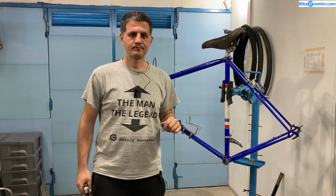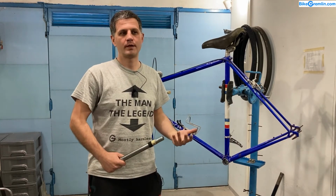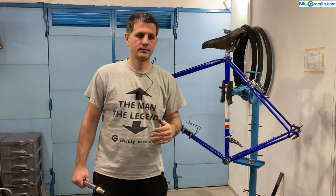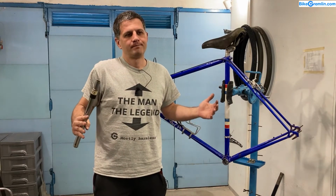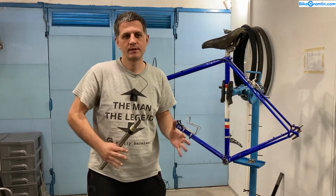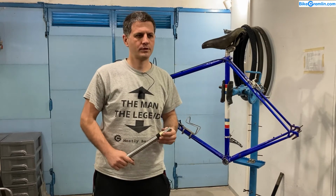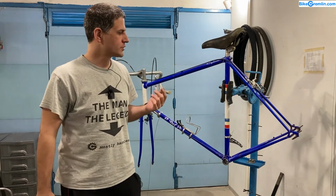What about road bicycles? That's what I also get asked. Well, there's no reason for heavy riders to not ride road bicycles, as long as you make strong wheels like I explained earlier. Go with 36 spokes, not saving a few grams or getting more aerodynamics or something. I'm not sure, especially for people who are very overweight. If you have over 100 kilograms, having 100 more grams on your wheels will not make that much of a difference unless you are competing or something. So it's better to err on the side of caution and make sure you have a worry-free ride, in my opinion.